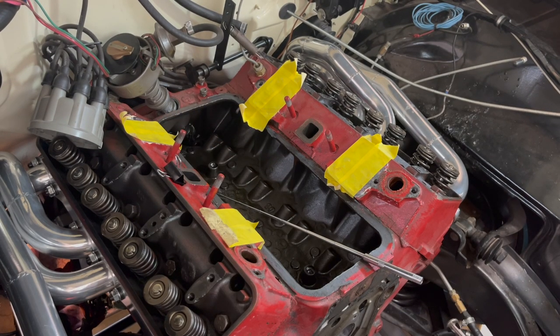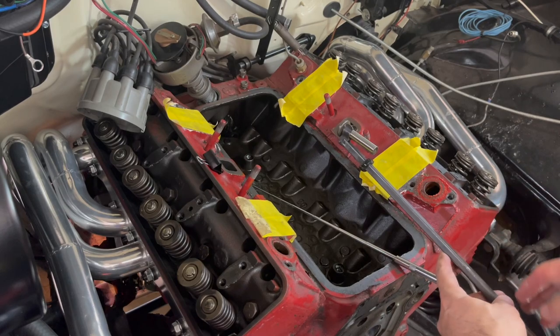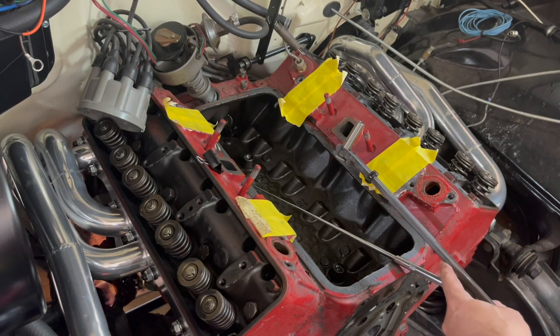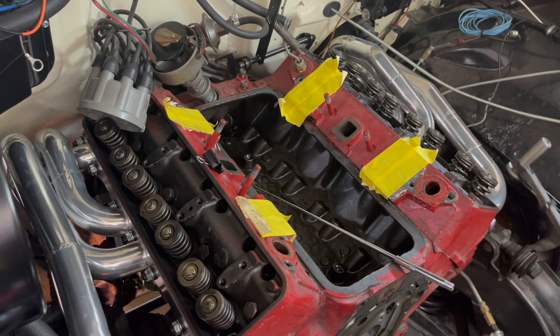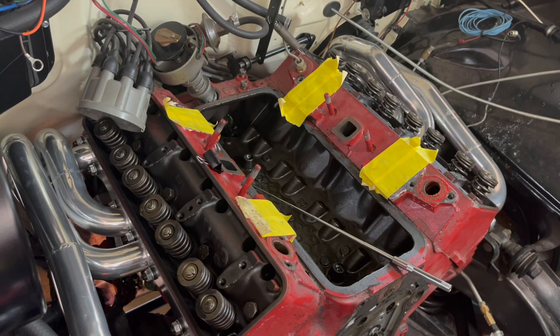And when I did this the first time, one of the things that I did do was I kind of went in here and just eyeballed exactly where the length of the shaft or this arm should be, depending on which lifter bore I was trying to get up into, so that when I flip this up in the air, I was very close and just had the right angle on it to get into the bore, slide it up in. So let's see how we do here with this one, and we'll aim for about right there.